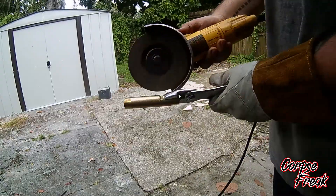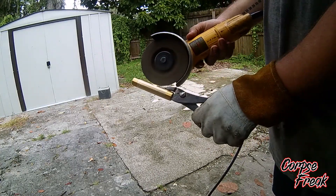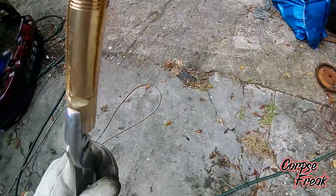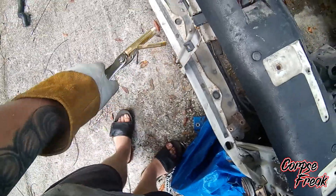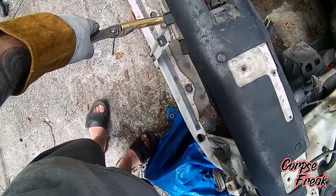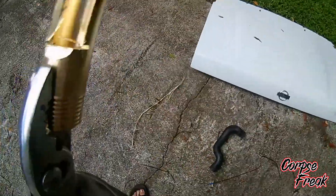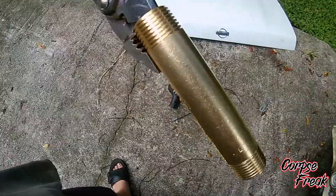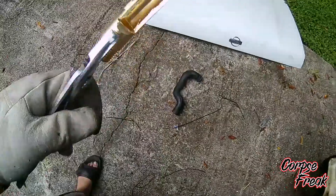This should be good — I should be able to pop it off. It's hot. I might have to clean it up a little bit, maybe widen the tip. The reason we go with a brass one is because it's a softer metal than the pickup tube, which is steel. So by hitting the brass one with the hammer to install the pickup, you won't damage the pickup itself — you'll just blunt the tip of this.